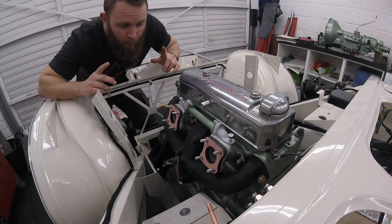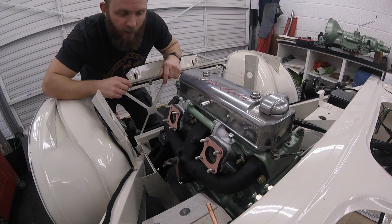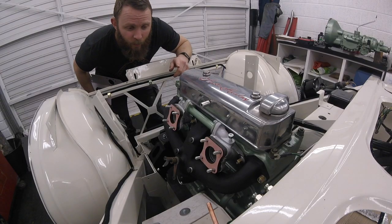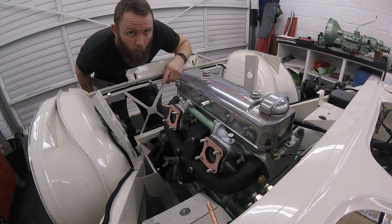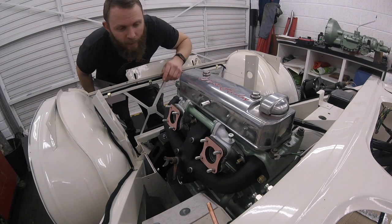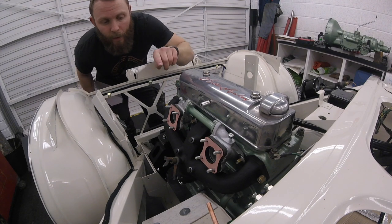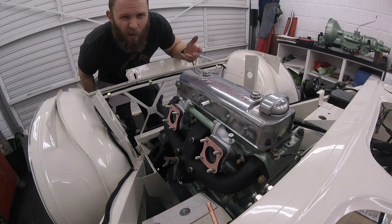That's all tightened up, but before I go any further I need to plug up with bolts these three BSF threaded holes, because that's where the original 104 heat shield would have gone. And as if by magic, they're fitted. Those of you that watch regularly might say at home: James, they were sheared off every week — you're never going to use them, why do you spend all night drilling, tapping and re-threading them? Valid point. But if somebody at some point wants to go away from the M-Spec and go back to original, they're going to have a hell of a lot of issues trying to get those three right again. Whereas now they can just wind three bolts out — job done. So it's the right thing to do, and it also looks a lot tidier because sheared-off bolts look crap, don't they?